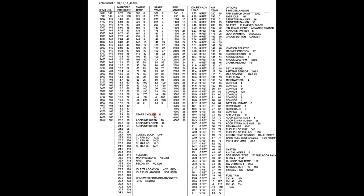Air temperature corrections are normally hidden in the programmer — they're a mathematical progression and generally we don't touch these. Start cycles control how long the start enrichment lasts before the computer reverts to engine temperature values. There's also an accelerator pump parameter for throttle response, a sensitivity setting for the throttle position sensor, closed loop settings, RPM fuel cuts, MAP fuel cuts, and many other parameters — too many to cover in this video.